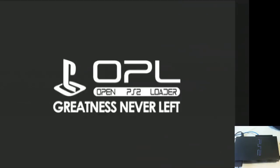Free McBoot is a softmod of it installed, you can see there. It's loaded on the memory card. There's a load of ways you can install free McBoot. If you've got a friend with a mod chip PS2, you can just burn the installer to a CDR and install it that way. You can do a disk swap with a retail PS2 game that you swap in for a backup PS2 game that's got U-Launch Elf on it. There's people on the psx-scene forums that'll install it for free for you, so if you want to visit there, they'll install it for you for free.